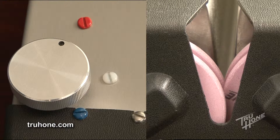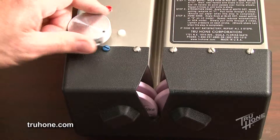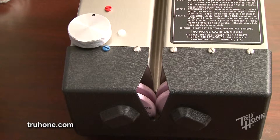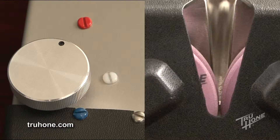If the honing wheels are not overlapped approximately 3/16ths to a quarter inch or 4.75 to 6.3 millimeters with the angle knob pointing to the red dot, turn the angle knob one complete turn clockwise and stop at the red dot. Visually check the honing wheels for no overlap or slight separation. If the honing wheels are still overlapped, continue turning the angle knob complete turns clockwise until the honing wheels are not overlapped with the angle knob pointing at the red dot.